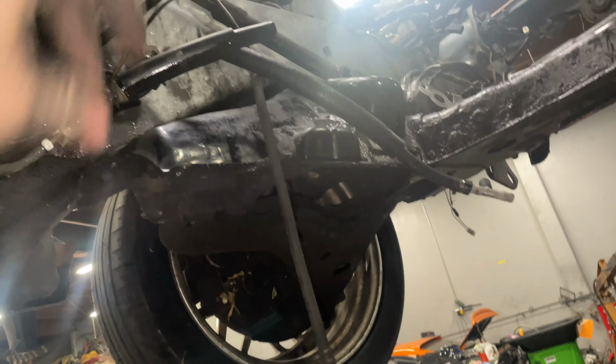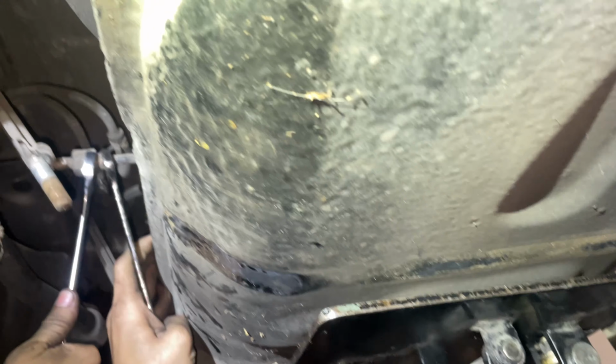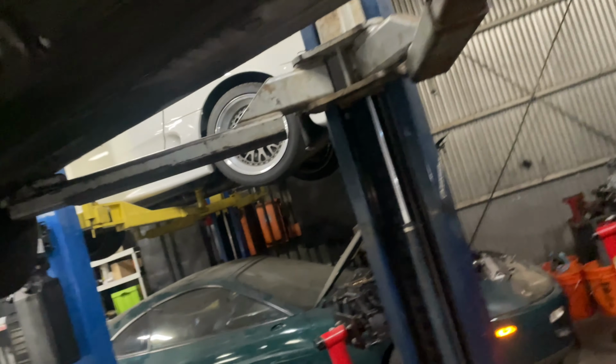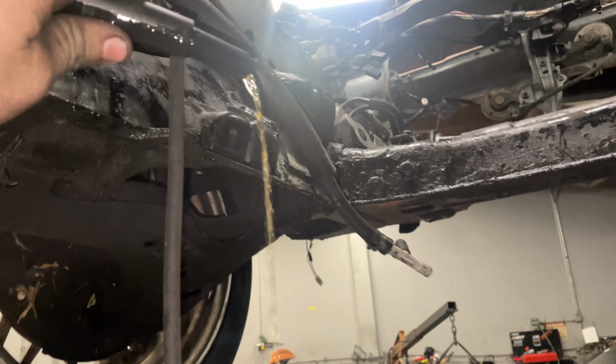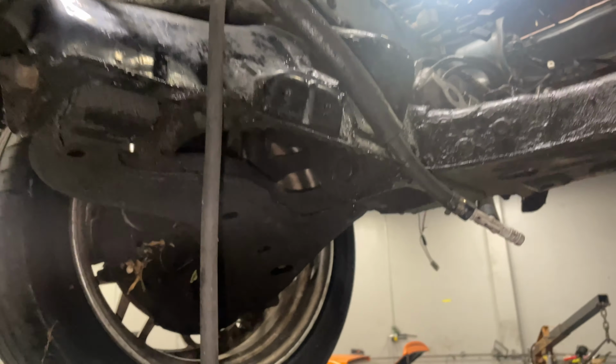We're gonna start taking out all these fuel lines and evap lines. Vinny's dropping the tank right now. That's what we're doing. One thing with Mk3s is their tank likes to rust pretty good. So once we drop this down, we'll look inside and see how bad it is. But, off the bat, I can drain this gas from the feed line right here. I don't know if you can tell, but it looks really brown. So, that's not really a good sign if it's that brown.